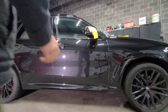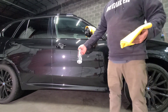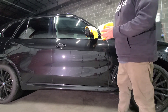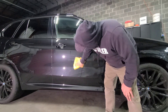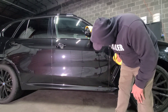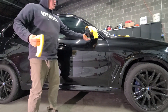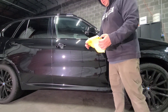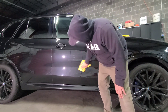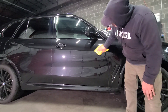To simplify things, I'm just going to demonstrate this on one panel. I take a clean application towel and my denatured alcohol — this isn't diluted or cut. I soak the towel, not the panel — kind of like applying a silica or polysiloxane sealant. I just want to go over it quick, buff it down, get all the areas. Then I use a quick-drying towel to lift any residues. I can feel immediately under the towel that the panel is very grabby now, versus the slipperiness it was after polishing. That's a good sign.